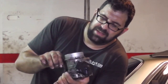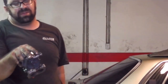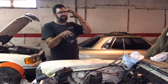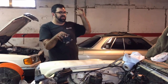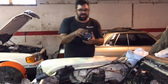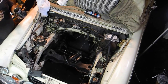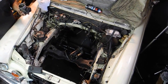If you don't have a healthy or working throttle switch, you'll get bucking or a loss of power at a specific throttle position. The car will be driving along fine, then at 50 or 30 miles an hour it'll just fall flat on its face. What's happening is the throttle position switch has stopped communicating with the computer, which causes messed up injector pulse times and a total loss of power.